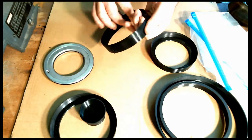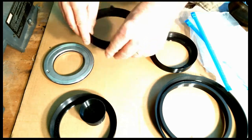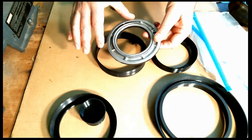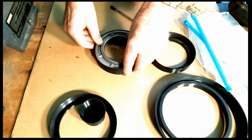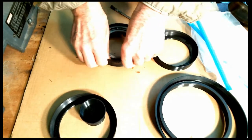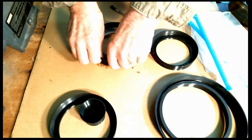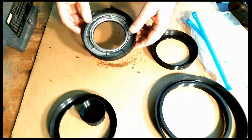And the way you use this, the tool, of course, has a taper to it. It has a kind of funnel shape. So the open part of the funnel will face up. We'll take the piston and I'll push it down into the tool. Now, as I go down in the tool, it will taper in and it will be a little bit more difficult to push it. What I want to do is push it all the way in so it's flush with the table. So get it in here like that, all the way to the bottom. And it's an interference fit, so it takes a little bit to get it in there. All right, I think I have it now. And you can see it's flush with the bottom. That's what I want.